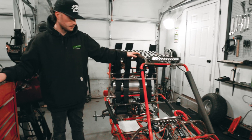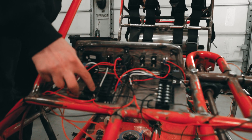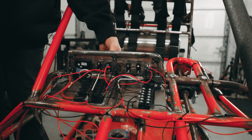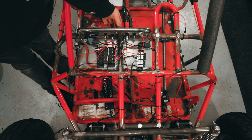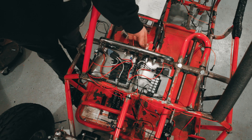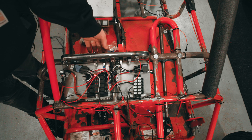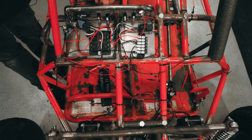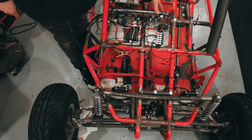What I can show you is this — on our fuse box, you can see those little lights. These will light up when you have a blown fuse, but they'll also show me that my switches and power are in fact working. So I'm going to turn on my accessory power. Accessory power is on. If we go to our high beams, you can see those light up on fuse six — we are getting power to them. Down low for our low beams, those are on fuse one. Over here we've got our ring lights on fuse eight — getting power to fuse eight. And our push-to-start — you can see that lighting up on fuse ten. So we're getting power to everything.